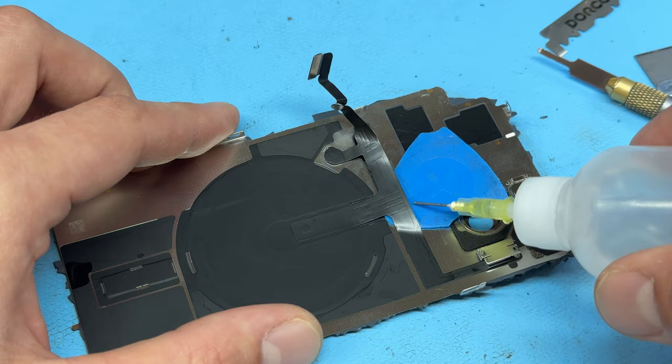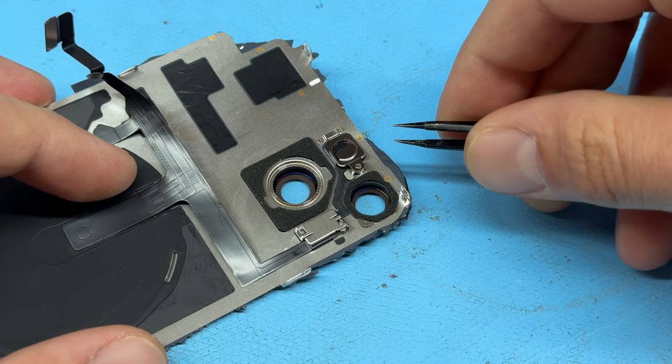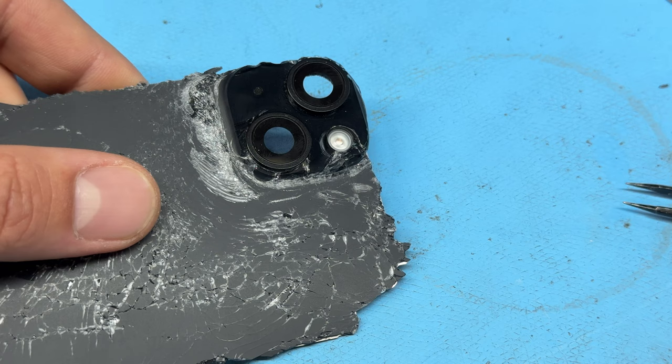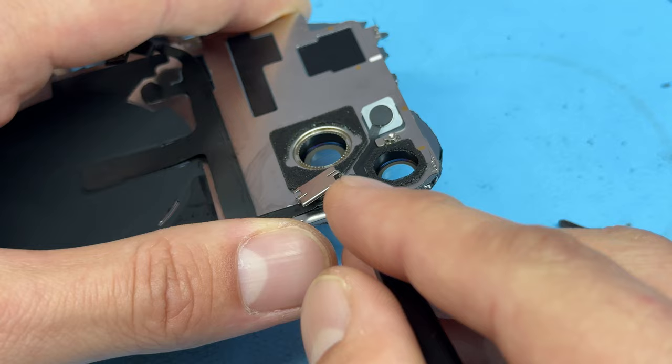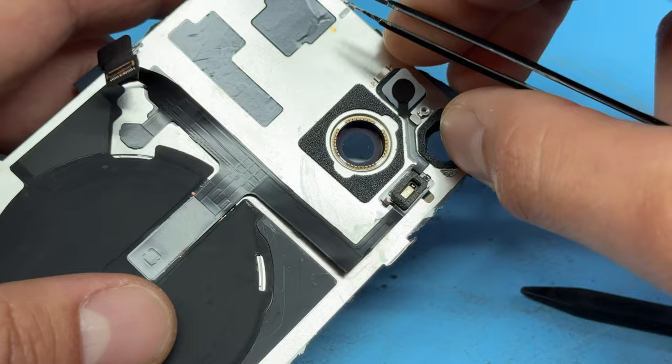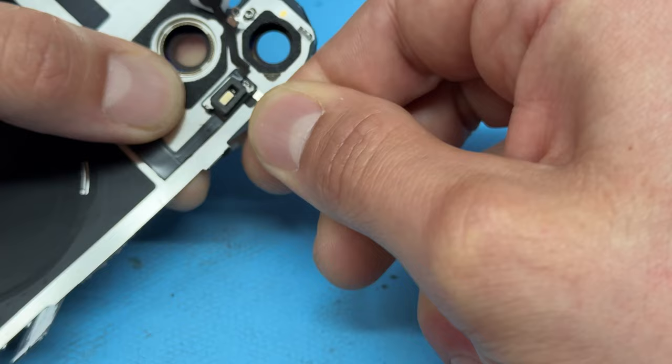If you find it's a bit tough, add some alcohol onto the pick itself and that's going to spread underneath. Take your tri-wing screwdriver again now and remove this little screw here. Use your tweezers to remove the shield — this is for the flash — and you can push it from the other side using the plastic spudger to poke it through. This shield is a bit trickier because it's sort of clipped in, so you need to pick it off — it's hinged and can be lifted off. I'm using the edge of the tweezers to help remove these flex cables.